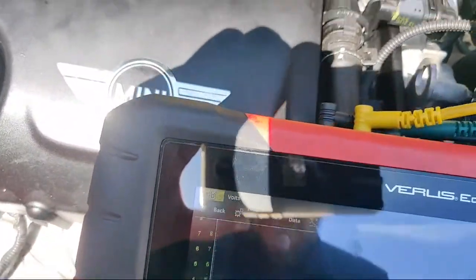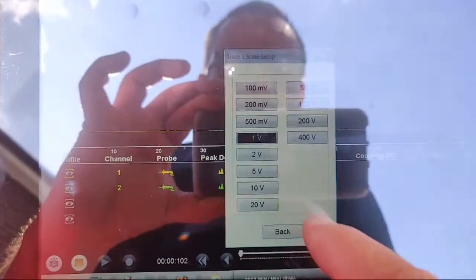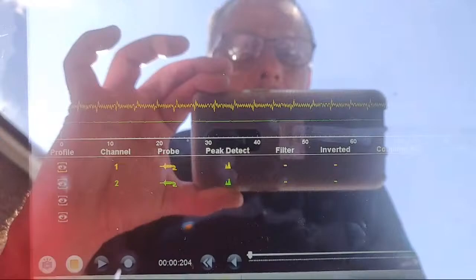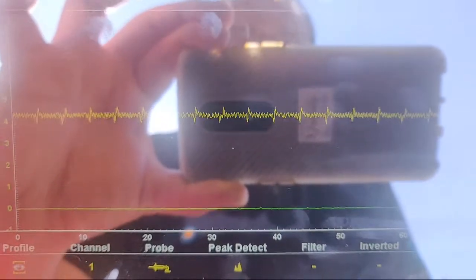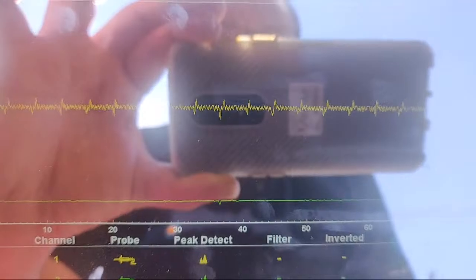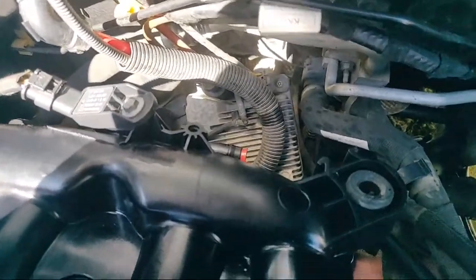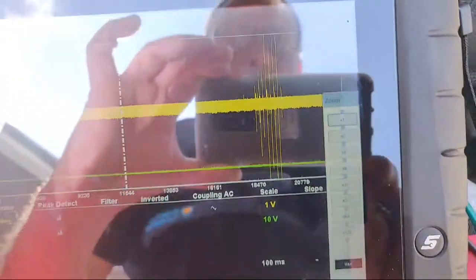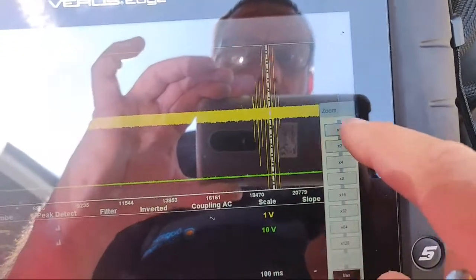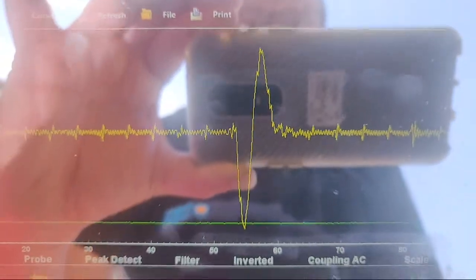So what we want to do is magnify the AC that's riding on top of that DC. I'm going to drop my scale down to one volt and AC couple it, and just drag my channel up a little bit. You can see now I've got a little more noise on that. I'm going to do the same thing again — I'm trying not to knock the starter motor out, just tapping gently. Stop my scope, zoom out — and there we can see it. Zoom in — there we go, we've got a signal off the knock sensor.